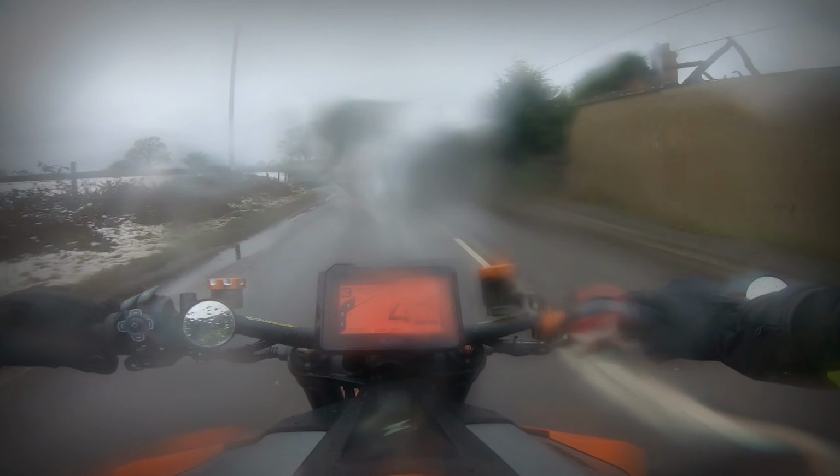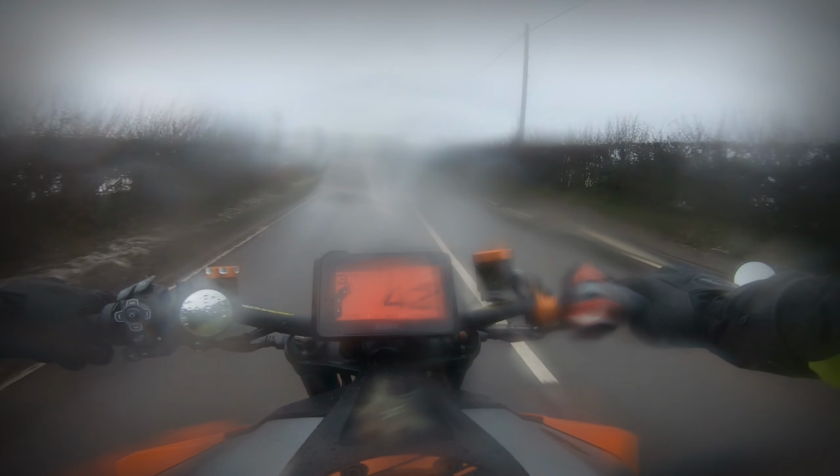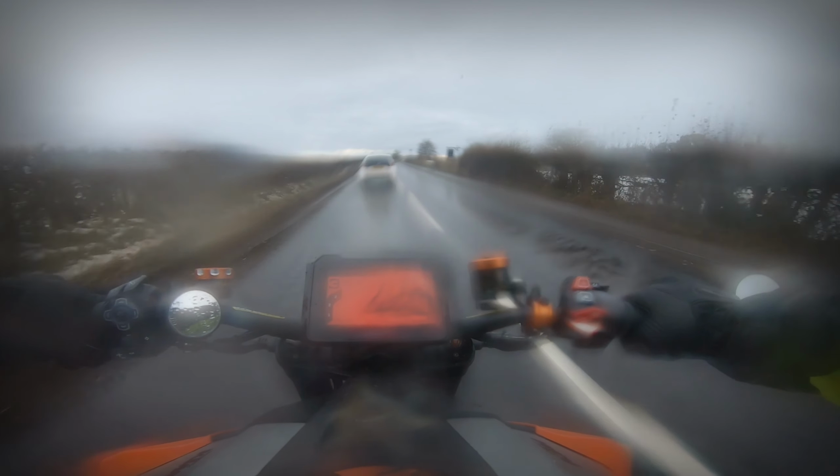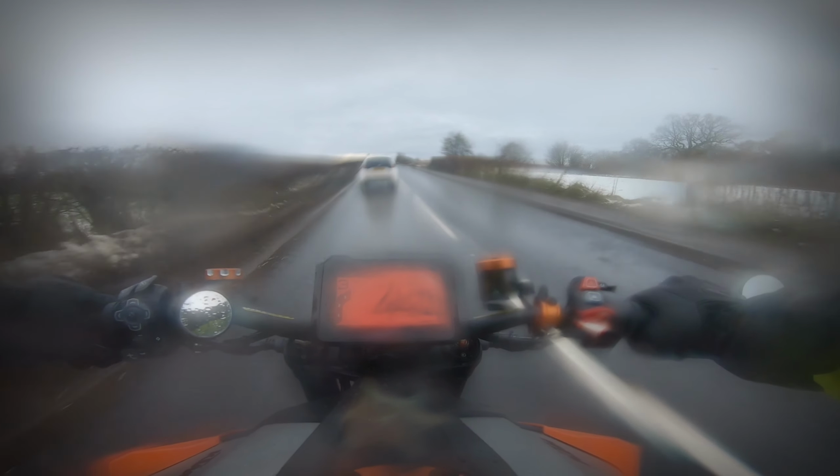I'd be coming out of a corner and I'd go up a gear, or go down a gear, and the bike would just bash you back and forth because the engine cut off and the engine braking starts to take hold. That doesn't happen now. You can still feel it cut. There's a little bit of a delay, but it doesn't jerk you back and forth. And when you're up in the RPMs, it's magical. It works really, really well, the QuickShifter, but it doesn't have that inherent danger to it feeling-wise anymore.